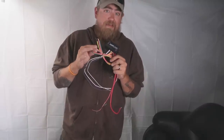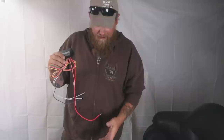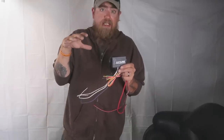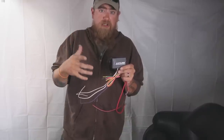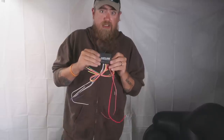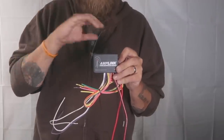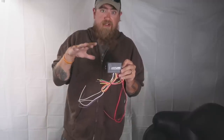I have four circuits that I'm not even going to be using at the moment, as well as two extra triggers I'm not going to be using. My main goal is to try and clean up the compartment, get rid of some fuses, and all that. The idea behind the Amplink is you're not going to need any fuses for your powered accessories — heated gloves, phone mount, GPS. This works as basically a junction box. If something does happen, you just reset that circuit and that's it. No digging for fuses, no having to worry about carrying spare fuses for every accessory that you have. Just reset the circuit and you're done.